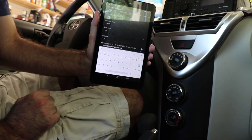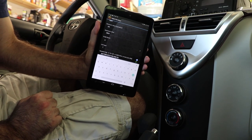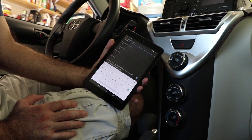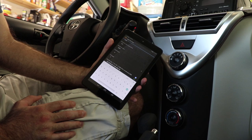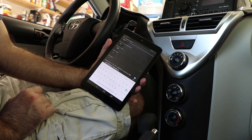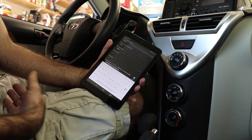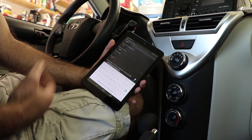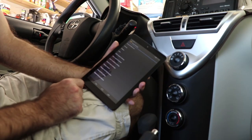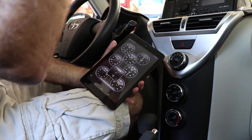I'd love to take credit for coming up with this, but it was a fellow on, I think it was like a 4Runner forum, who had originally figured this out. So all credit to him. I'll see if I can find a link to his post in the description so you can go and read for yourself about it. But this equation here translates the raw values that come out of the OBD2 port into an intelligible value that we can use to monitor the transmission temperature sensor. So we're going to quit out of this, go back to here, and we'll go to real-time information, and it goes to our gauge display.